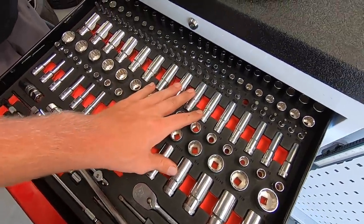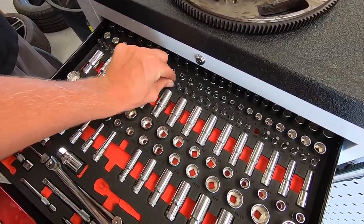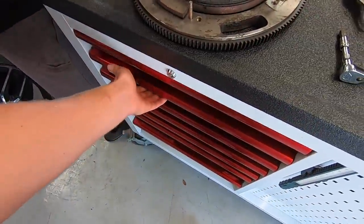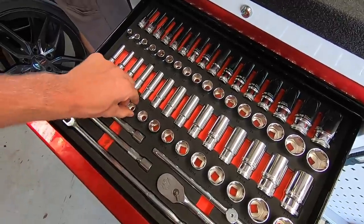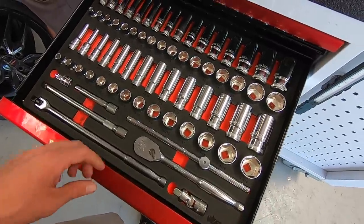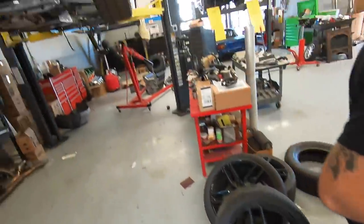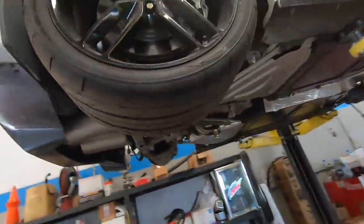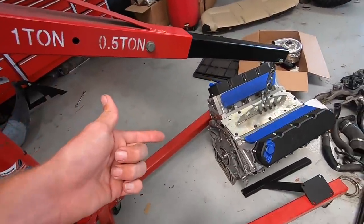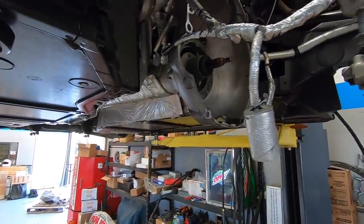This Boxo toolbox has been awesome — it's so satisfying putting the tools back in; they have a nice little groove that pops right into place. James has been killing it with it. Today we are going to be reassembling the C7 — at least getting the engine in. First things first, we've got to put a clutch on the back of this thing, then we can go in from the top, slide it back onto the torque tube, and be in good shape.